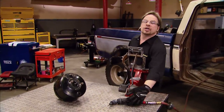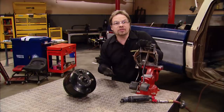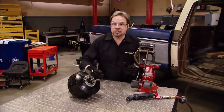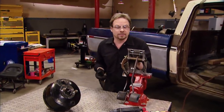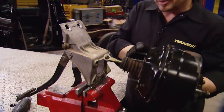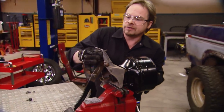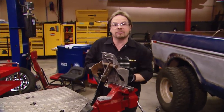We needed to buy about an extra half inch of room to make the brake booster work with our new four-valve super-wide cam covers. We even thought about going to a hydro boost system, since it is rack and pinion with power, and a lot of later model Mustangs live happily with that system because it's narrower. But the more we started looking and measuring, the easier this project got. This is the brake and clutch pedal assembly — it basically sandwiches the firewall between the booster and the bracket, bolted into the top of the cowl from the inside. By slotting this, we effectively create our half inch of space to drag the whole assembly toward the outer apron. But slotting this is only half the story.